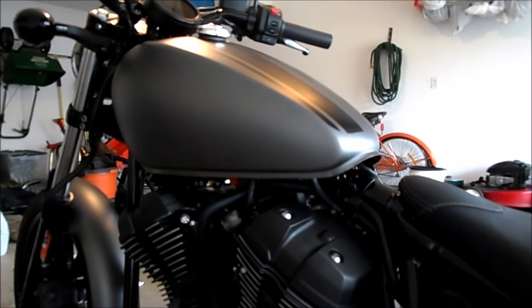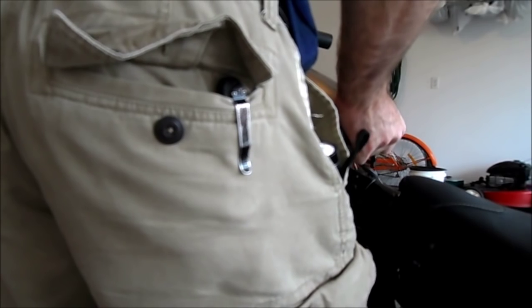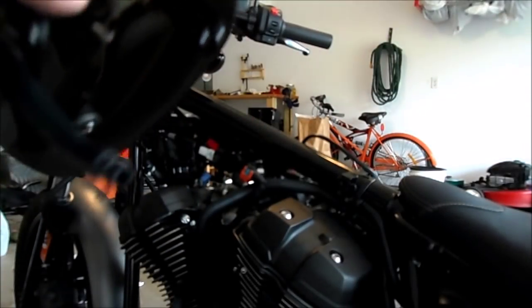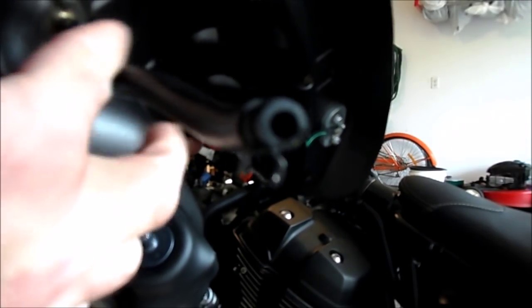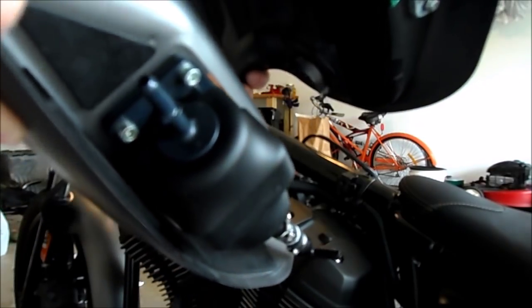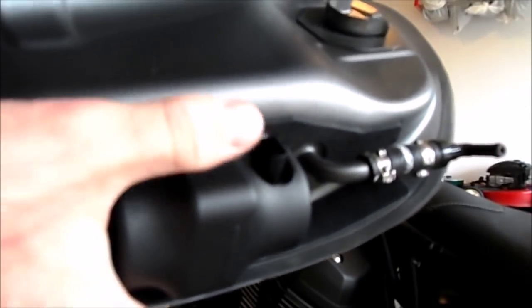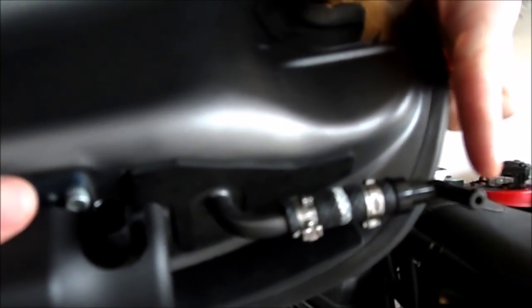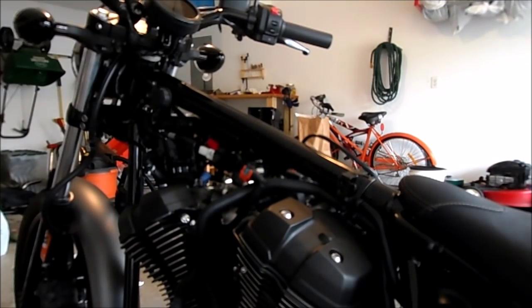Now I've taken off those five connections and I'm going to pull the tank back and off the rubber grommets. There are two rubber grommets here but you can't see right now, so I'm going to pull back and wiggle, wiggle, wiggle and the tank comes free. I've got this vent hose right here and you can see where that goes up — there's a little clip. You can see the starter motor here. The blue clip went back here and this one here is kind of the difficult one. I'm just going to set this down on some towels I have laying on the ground.